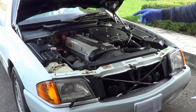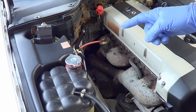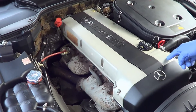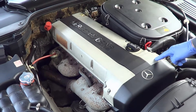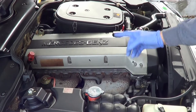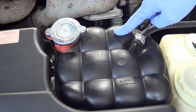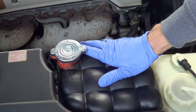The first is to check the coolant level. The coolant reservoir is where we check it, looking at both the level and the color of the fluid. Both are very important. The coolant protects our engine from overheating, and if you neglect it, it will likely lead to very costly engine repairs like head gasket repairs or an engine rebuild. It's extremely dangerous to check the coolant while the car is warm, so you'll want to check it early in the morning or when the car hasn't started for many hours.